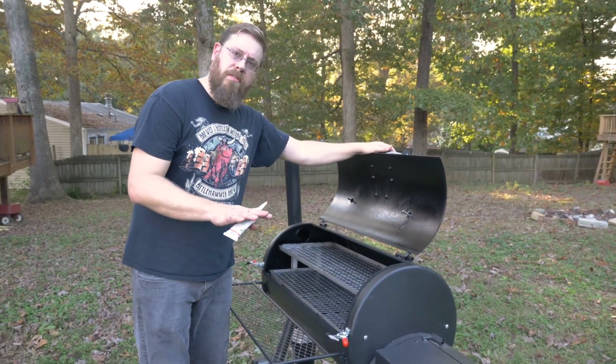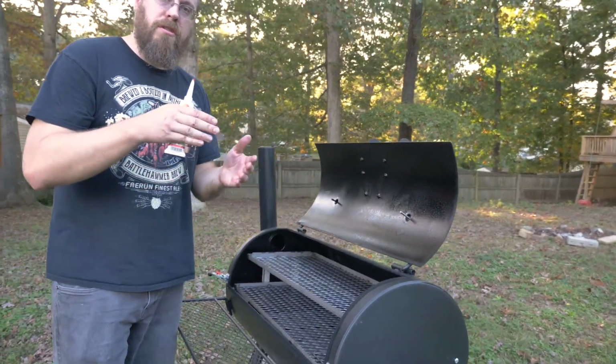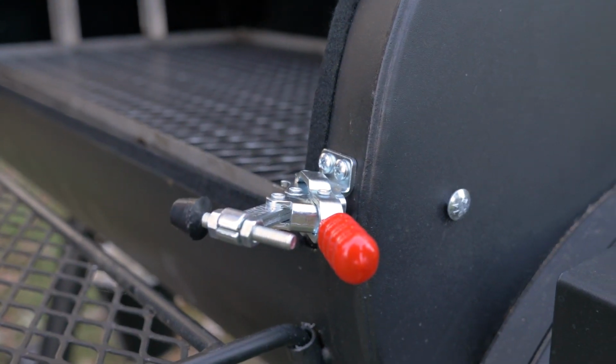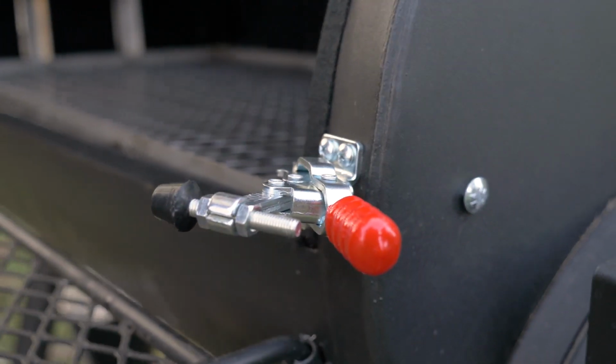One of the other tips you want for this mod is when you're drilling these holes, if you've ever done any type of metal fabrication, you know you start with a small hole and you work your way up. Now, we went 4 different bits, keep on walking it up until we got to the size we needed, 3/16. We were able to get those pilot holes just right.